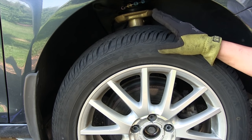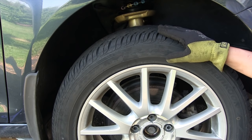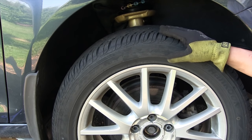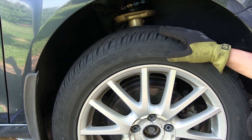You also want to isolate any kind of road or tire noise first. Make sure your tires are balanced and don't have any strange wear pattern causing a roaring noise, or that you don't just have cheap or old tires that are noisy.